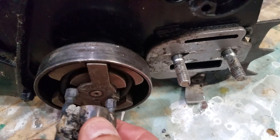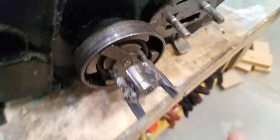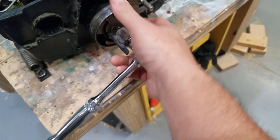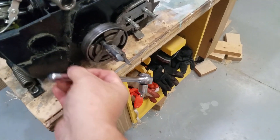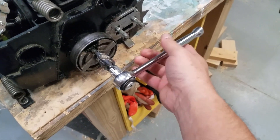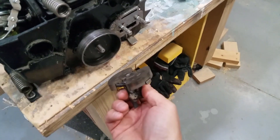See, it goes right here in the clutch — like that. It is a little tight but there you go. And then you just hook your socket right up to it. The clutch is on there, and it has left-handed thread so you are actually going to go clockwise instead of counter-clockwise to loosen. I have already got the initial pop off when I was testing it, but this is basically how it works. It would be a lot more forced initially to get it off, but then you just keep unscrewing it — and ta da, that is it.